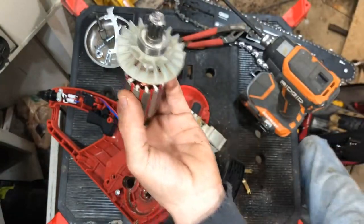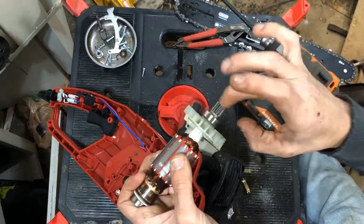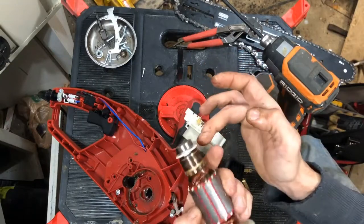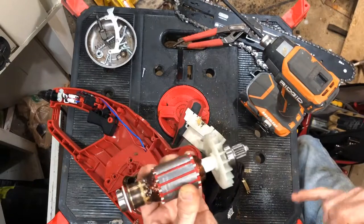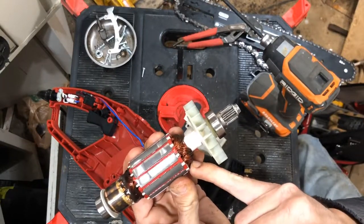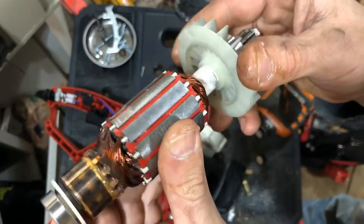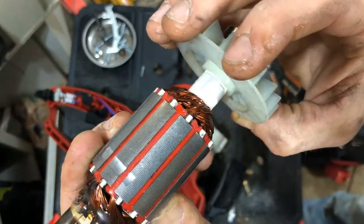You can see how our pinions attach to the whole motor shaft with just this little bitty nut. There's no keyway — this thing is just slid onto the shaft and then compressed with this nut, and that's enough to transfer all the torque from this motor to that pinion. You can see a little bushing right here to protect the bearing from all the arcing on the commutation bar. The wire here is probably 22 to 24 gauge. You can see where they balanced it — took something beefy and cut that out, same at the front with a smaller one. They took out a good amount of material over a bigger area.